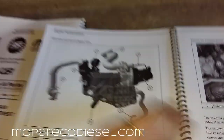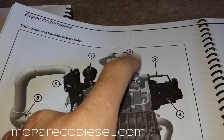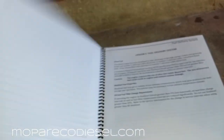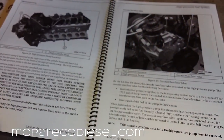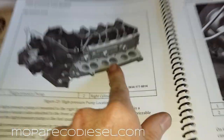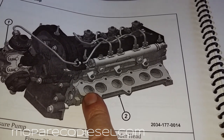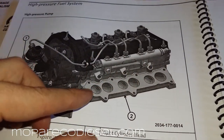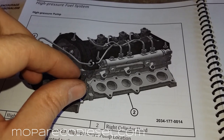Here's our air intake and here is the EGR diffuser tube — this is what I removed. Right here and on the other side, these are both 8 millimeters and these two are 10 millimeters. You just undo those and it literally just pops right off — that's all there is to it, pretty easy to maintain and clean. We have two ports to our intake: one side is a straight-through shot and the other side is handled by a butterfly valve called a swirl motor.